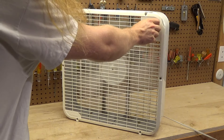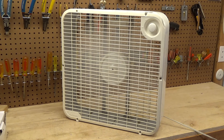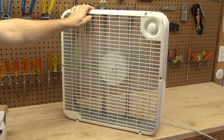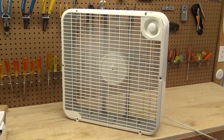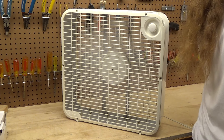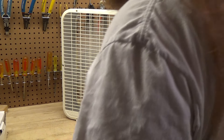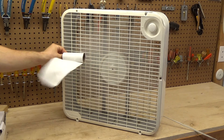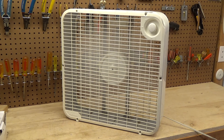Now let's try the medium. There we go — there's the power. That's throwing some good air now. Of course it's horribly out of balance — that balance is atrocious on this thing. That's 1.04 amps, 93 watts, power factor 0.76 — that's much more like what I would have expected. It's throwing the air pretty good now and it's still not that loud. I think this blade set was not all that bad. It's thin, it's flimsy, etc., but in regards to performance it's halfway reasonable — not overly loud and pushes a decent amount of air without needing to draw a lot of power.